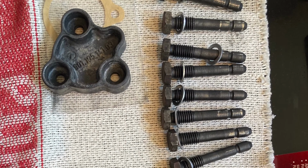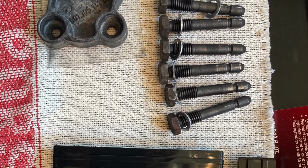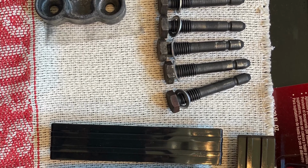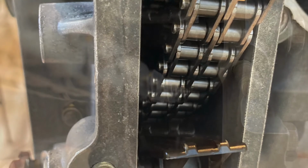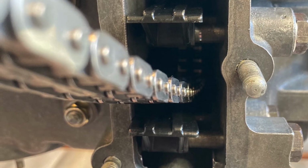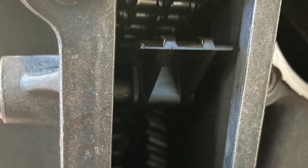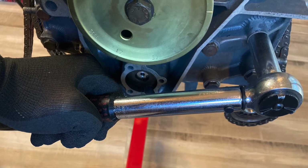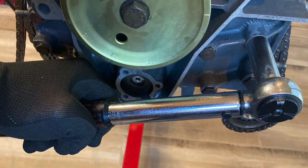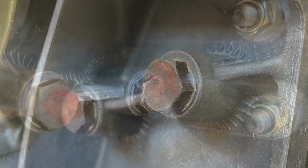Okay, so let's go ahead and move forward with mounting the 4 inward chain ramps. The brown chain ramp is mounted in the lower right position as you're facing the motor, and then the remaining 3 are the standard black chain ramps. When you're mounting the chain ramps to the case, you do want to make sure that the longer ends are pointing towards the center of the case. For each of the chain ramp bolts, you also want to apply a new aluminum seal, and torque down each of those bolts to 18.4 foot-pounds of torque.